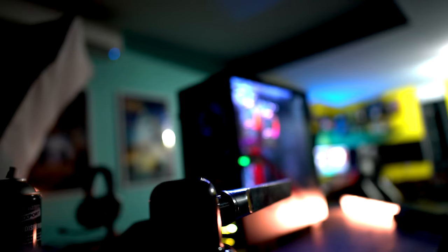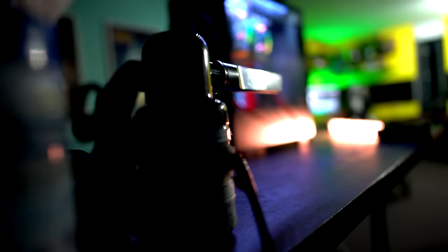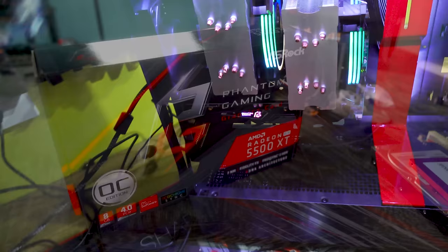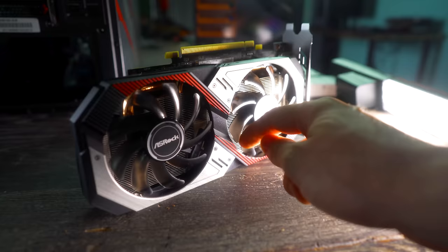The reason I think it has this problem is because of this legacy card here, like a really old graphics card, GTX 580 and before, they will work fine. Like you can go offboard VGA and then it'll boot fine still. It's just the newer graphics cards have the updated VBIOSes on them, and that causes issues on a lot of these older boards. And in this case, yes, the 5500 XT with that newer BIOS and the fact that it's a newer GPU, and if you got like a GTX 1660 Super or something like that, you would still have the same problem in booting up.